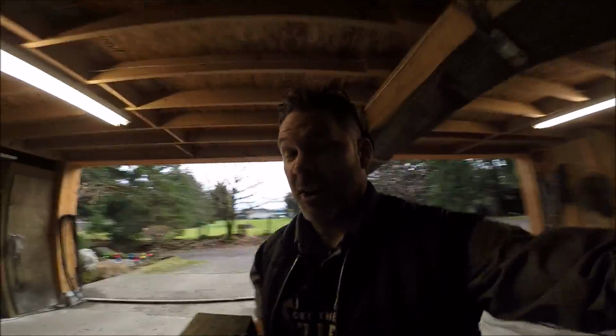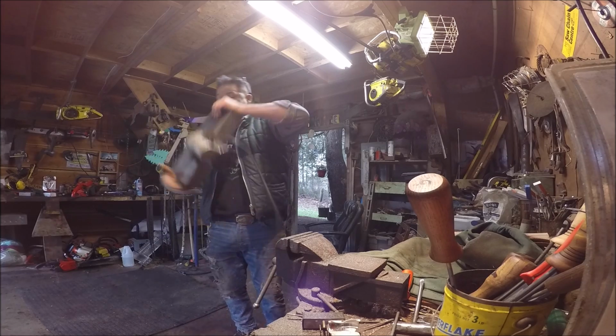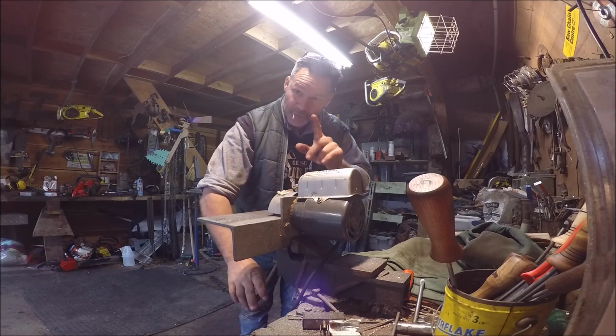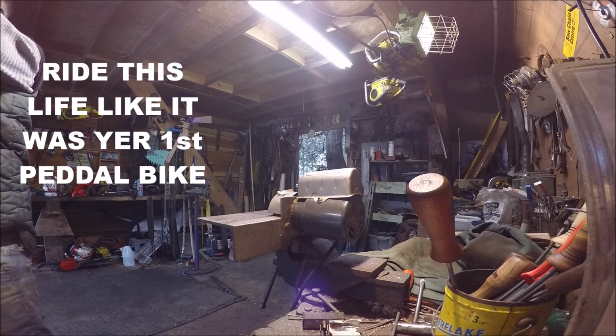I'm going to see if I can find another brutal bar. And you should take your bar off. If you've got the same bar on your power saw that you've had there for a long time, take it off. Take a look at it. And investigate it. If you're having cutting problems, you better take a look at your bars, friends. Who's having fun? I sure am. It's not always your filing, but it sure well can be. A lot of times it is. But if it's not your filing, it's your bar.